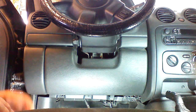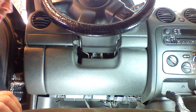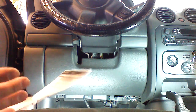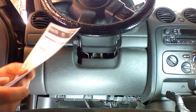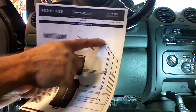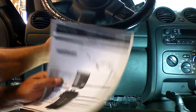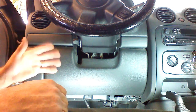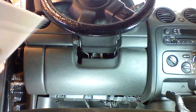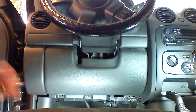The way that the vehicle is done is determined by whether or not it has transponder based anti-theft and the features that you want to get. If it has transponder based anti-theft, then we will do an anti-theft interface up at the skim module underneath the steering column cover plastic. With this particular vehicle, we don't have to do that because it's a black key version. So when we get to that point in the video, I'm going to show you what to do.